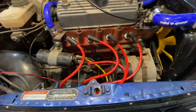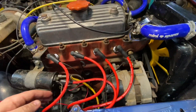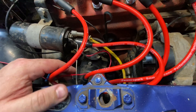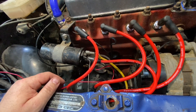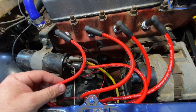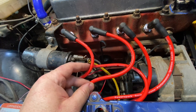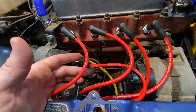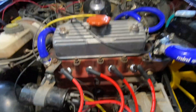Okay, so we're under the bonnet now. I've already started on this one, but just to give you an overview. This is the usual MG Metro conversion in a mid-80s type Mini. It had the ballast feed connected to the coil, but this has got a 65D dizzy and if you know anything about ignition systems fitted to Minis, this should be running a full 12 volt feed. So I've run in an extra cable and got rid of the ballast feed - this is now up to full power. I've put a new set of HT leads on along with BP6E spark plugs gapped at 35 thou. The factory leads had gone hard and the insulation was on its way out. So with non-resistor plugs that has certainly sharpened the engine up. Now we're going to move on to ignition timing before we go to the carburettor.